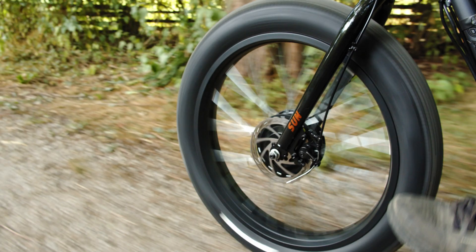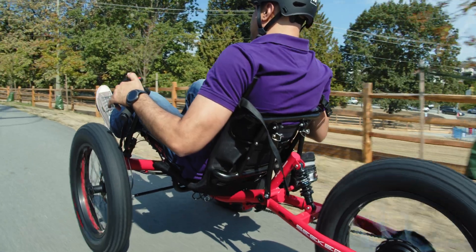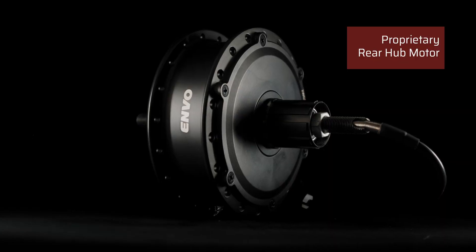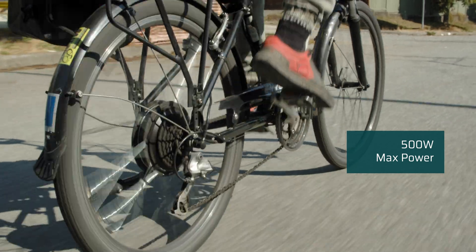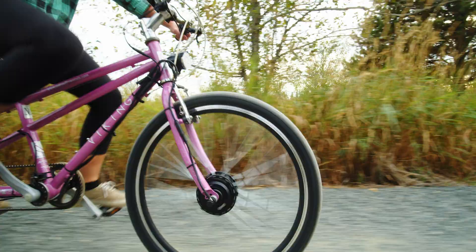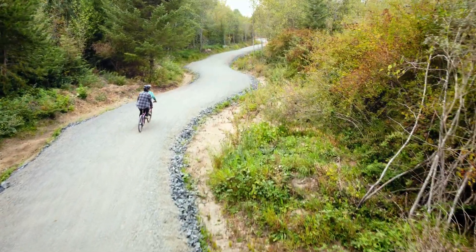The proprietary sealed, geared hub motor is available in front or rear options and can be ordered in all the common wheel sizes to guarantee the perfect fit for your conversion. These rims are made with heavy gauge spokes for increased load capacity that electric bikes encounter. There is also a hub-only option, allowing you to build a custom wheel on specialty rims or to upgrade your current build. This powerful motor delivers up to 500 watts of power and up to 60 newton-meters of torque, and the sealed bearings in the hub make it virtually maintenance-free for up to 20,000 kilometers.